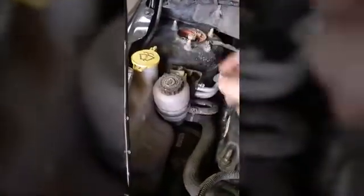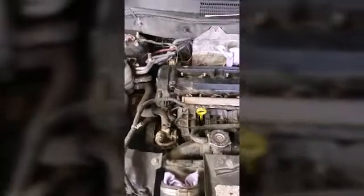This is what it should look like after you've removed your charge pipe and your coolant reservoir. I did loosen this off too - it's 10 mils for that, 8 mils for this. I went ahead and removed all the 8 mils that do my valve cover, and I also took my ignition coil off. I always place the bolts back where they came from just so I don't get confused on where they go. Now I'm going to put the car up and we're going to start getting into draining the oil and pulling the timing off and serpentine and whatnot.